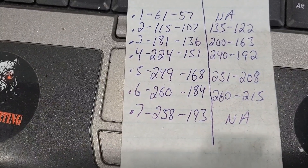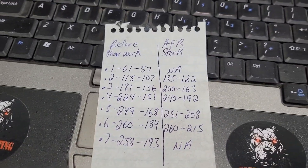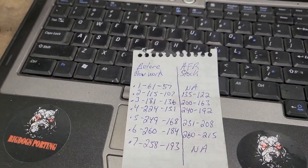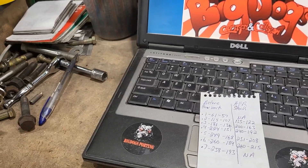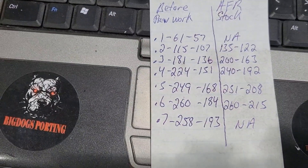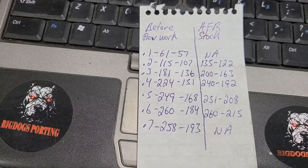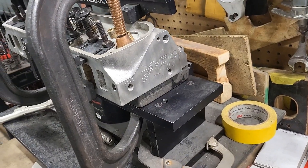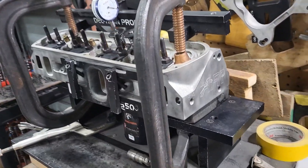The low lift and mid lift is just really suffering on these. And this is one of the reasons we tell you guys — we're not just trying to sell you a product. We have tons of customers, so that's not the issue. We're just trying to prevent you from winding up in this situation. We're definitely going to have to put in a lot of work on these particular heads because they've been previously massaged, cleaned up, or whatever you want to call it, and the flow is really hurting.